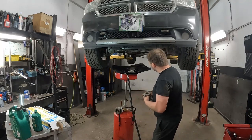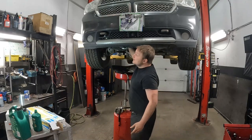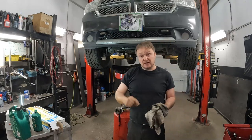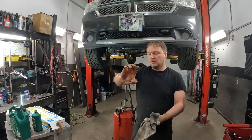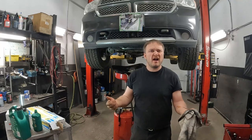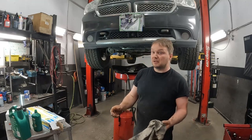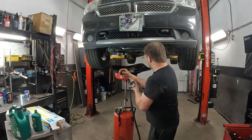So, I'm a firm believer, and I don't want my oil filter coming off while I'm driving, so I make sure they're tight. Usually, if you look at the oil filter, they'll have instructions, particularly the Napa ones. Those are pretty impressive. They'll say to turn it until it's snug, until it's down, and then turn it another half turn to three quarters of a turn. Well, I think I tighten mine a lot, and I can barely get a half turn after it bottoms out. So, I like them tight, I don't like them coming off.